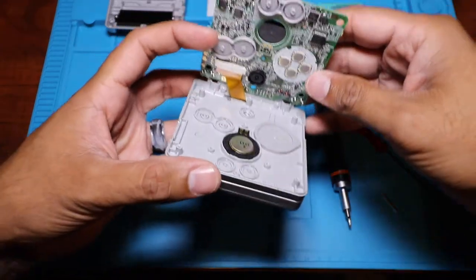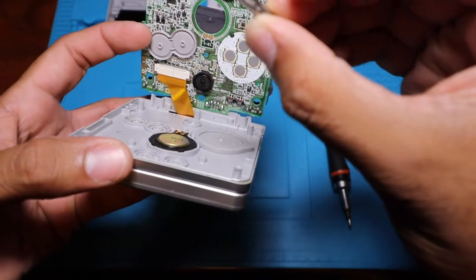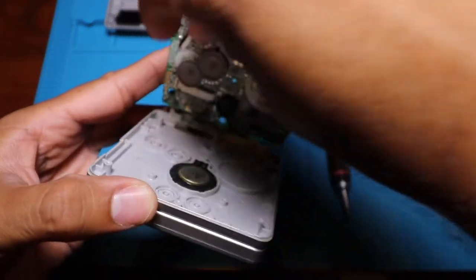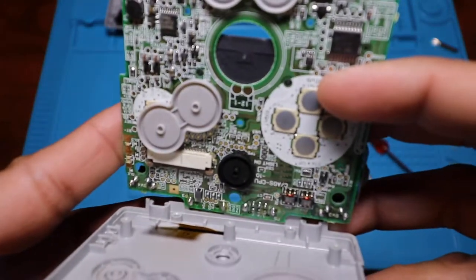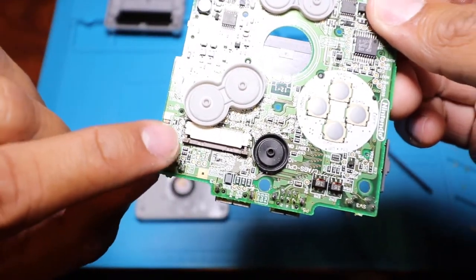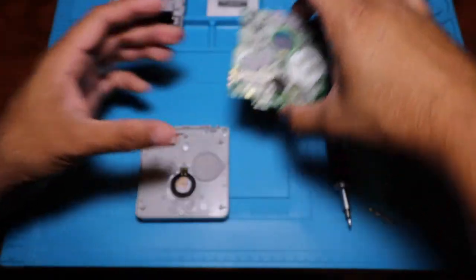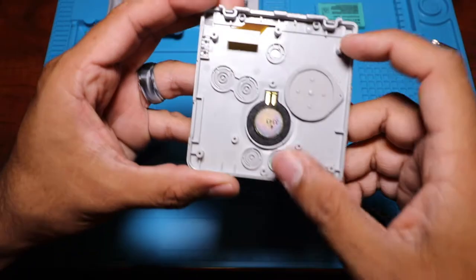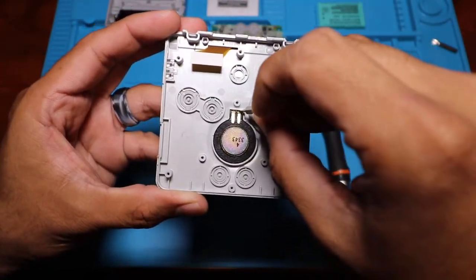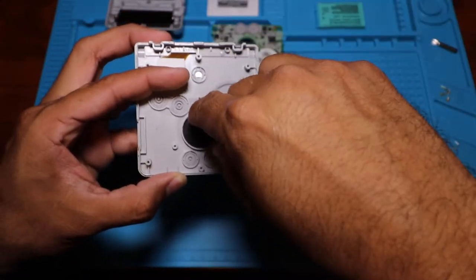Basically what you can do is lift up on this piece here. As you can see there are some pads for the controls, but also this ribbon right here — be careful. You're going to want to use something small to pry it out. There are little tabs in the corner of each connector; push down on them to release the ribbon cable. Be very, very careful because that ribbon is for the screen — you don't want to damage or break that. The little tabs on the side come out very easily, so just use a small flat-head screwdriver tip. You're also going to want to remove the speaker. Be careful, as there's a little foam piece on the speaker that you'll want to make sure you take out as well.